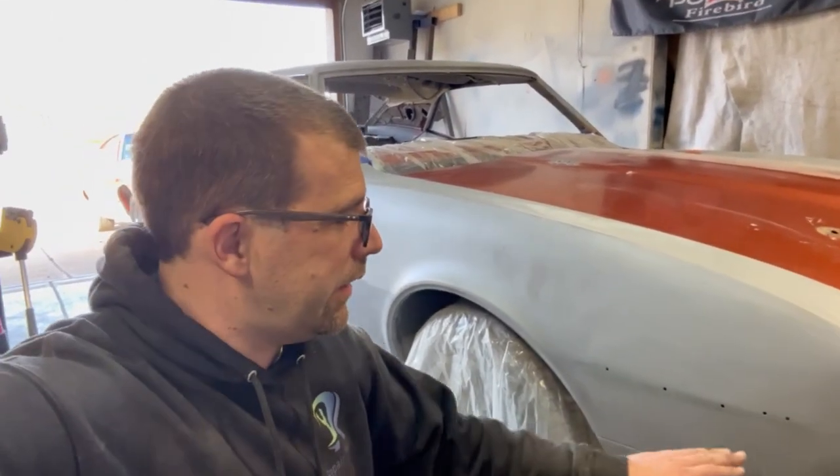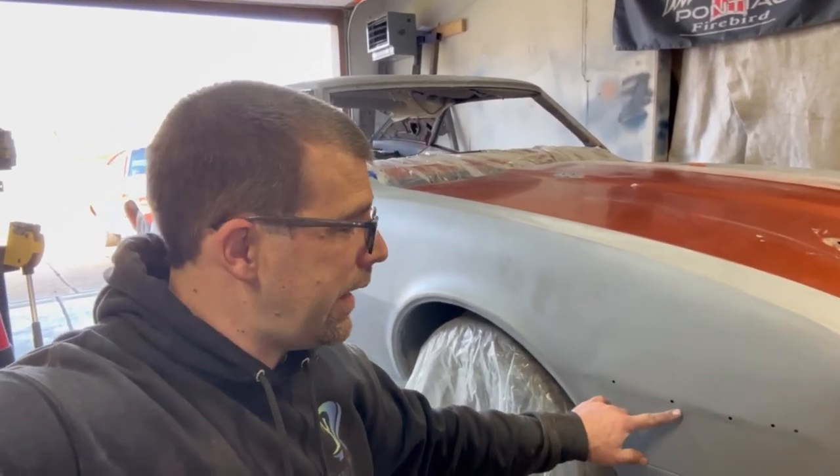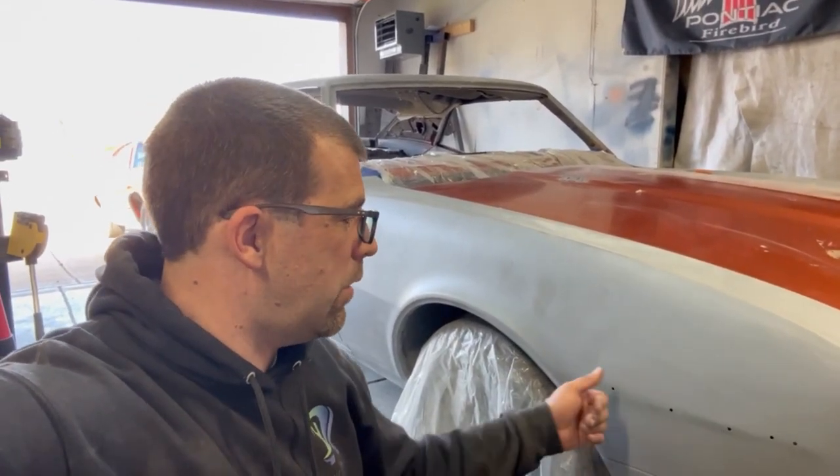It's just not an area that I have the skill set to actually get that line put back in by just the sheet metal alone. I got it close, but we're just not there. So how am I going to finish it now? I'm going to use a little bit of body filler — not in excess of maybe an eighth of an inch — to fill in the imperfections from hammering and dollying, and we're also going to redefine that body line. Let's get started.